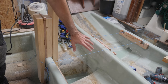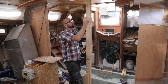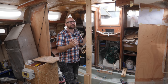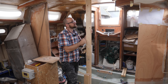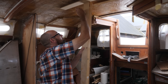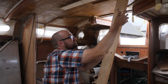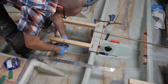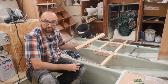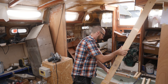That's the first two of the five supports in place. Now I just need to rinse and repeat over here, but before I can do that I need to remove the cabin top support. I put this up to avoid having the cabin top sag over time until I've finished this area down here — so it's not like I'm expecting the cabin top to come crashing down when I remove it, but it never hurts to cross your fingers. And there we go, everything is lined up correctly. I'm going to hurry up and remove these before the thickened epoxy cures because there's no need to mount these just yet. Now let's get this support back in place.